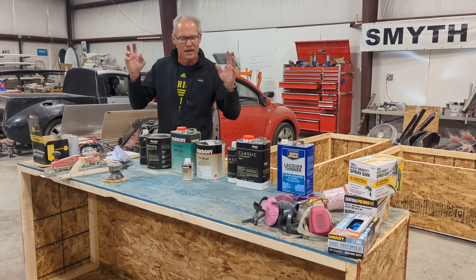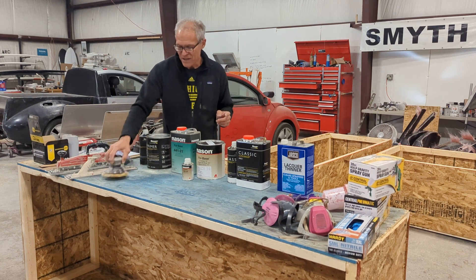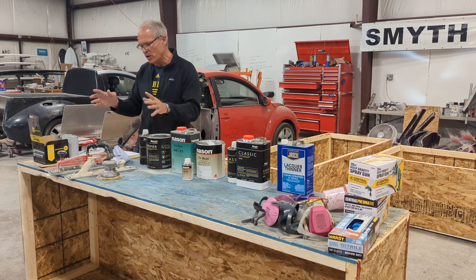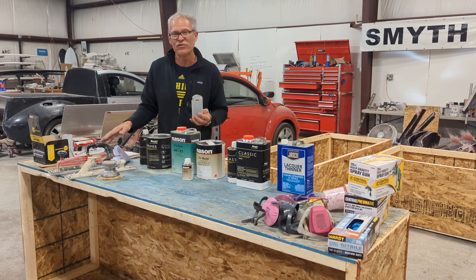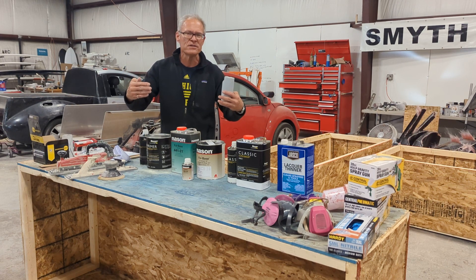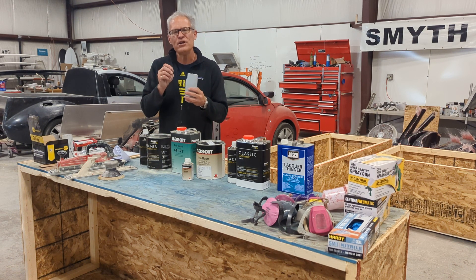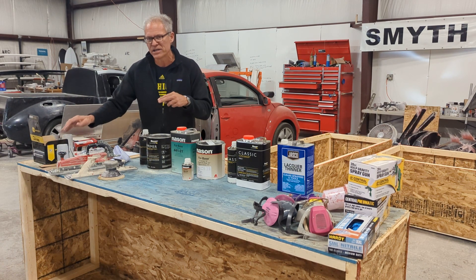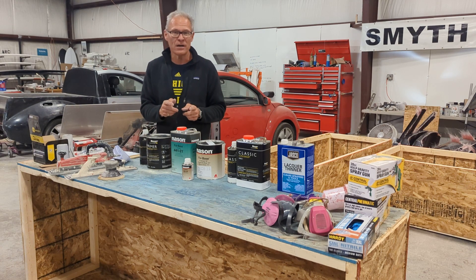You've got your fiberglass all sanded down, your car pieces mounted. You're going to start sanding 80 grit — 80 grit — and you've got a pretty rough surface in front of you ready to start working on. At the very end, when you're done with your Bondo work and you're sanded rough at 80 grit, you're going to take out your 220 grit discs and hand sand. I don't really use mechanical sanders for the 220 grit sand — you're taking that rough surface with deep gouges and smoothing it out so it's ready for primer. That's your 220 grit sandpaper.